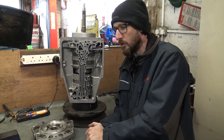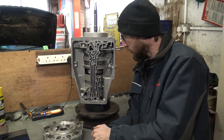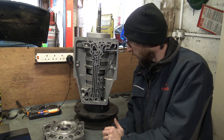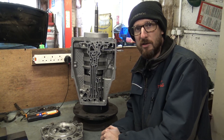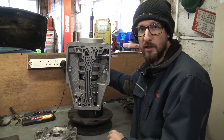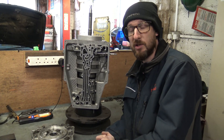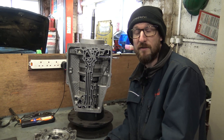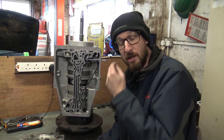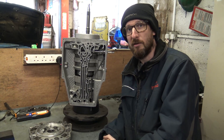Everything stripped out of this gearbox — the clutches were all in good condition, there was no blackness to any of them really. A little bit of tainting of black on a couple, but nothing to concern ourselves with. Whereas I have stripped boxes down where the clutches have been completely burnt out and the metal plates between them have been heated the whole way round and warped. So hopefully the next video will be a quick one of this actually fitted to the car and the fuel pump installed. The car will still run and drive through all gears and I'll still have reverse. Then hopefully I can start looking at installing turbos because lockdown restrictions might be lifted. I was going to say see you next year, but that's not actually that far away now — and with everything that's going on and my potential house move, we could well be in 2021 before the turbos are on.